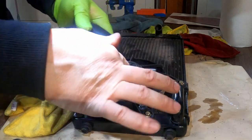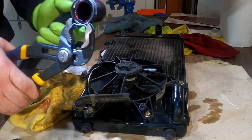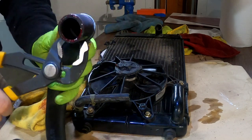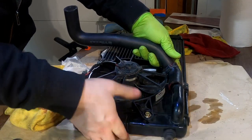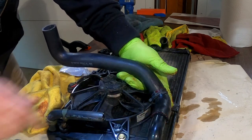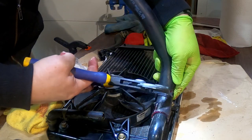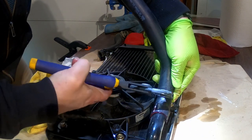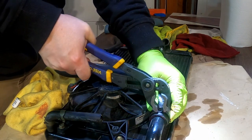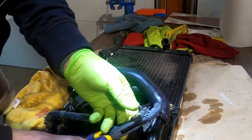Red rubber grease is a good way to condition your hoses — clean them and wipe them off with a rag. Squeeze the clip, get it up in there, make sure it comes all the way up around. Right about there is where the old line was, so that's roughly where it's going to have to go. Usually you want about two millimeters on either side of wherever the clamp goes. I like to make sure I can get to the clamps. Brand new hose clips can be a little bit of a pain to get back over that hump — make sure it's on this side of that little bump, then release. Moving down just a little bit — there we go.